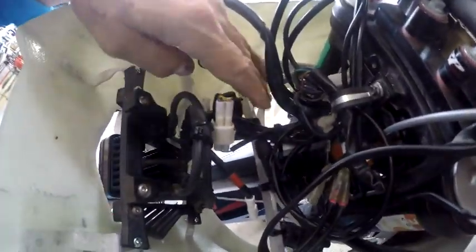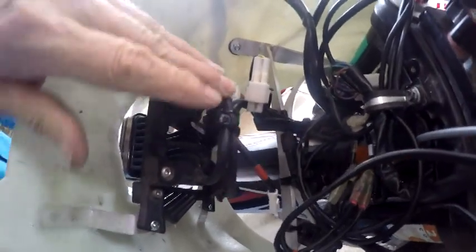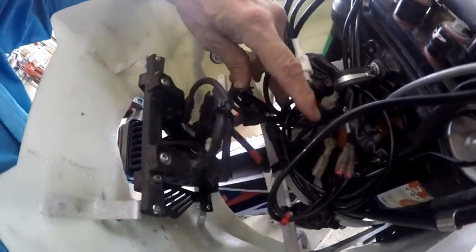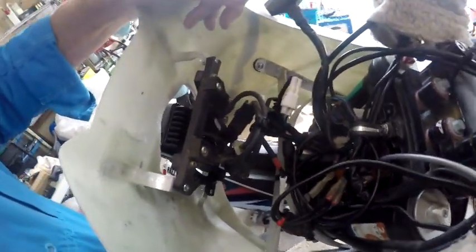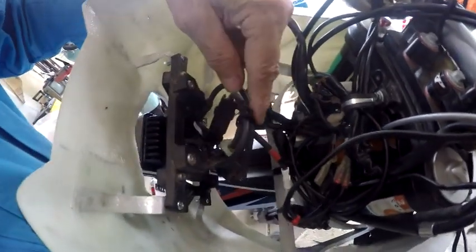These cables, the brake and ABS, this is going off the main harness. Trying to keep it really tight and small in here. And then the wires going to the headlight is coming up to this particular part. I don't want to attach any cables to the headlight if I don't have to, although I just did, because if you pull the fairing off, then you have to cut the tie wrap. So I'll get rid of this tie here.